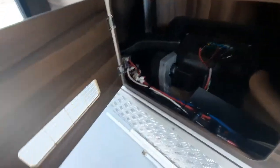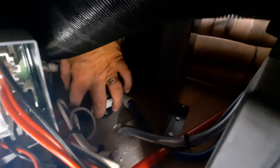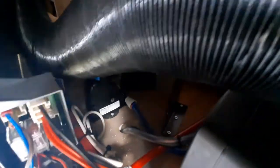To the side of that we've got a little locker area and this is where you will find the boiler. Within the boiler itself, just down in this little area, you have your frost protection valve. It has a diamond at the top and a little push button at the front. You'll need to make sure that the diamond is pointing across the side of the vehicle and the button is pressed in — that is the operation button that needs to be pressed in place when you want to fill up the hot water on the system.